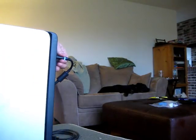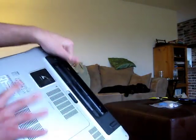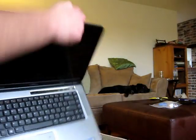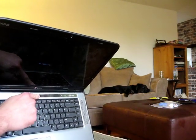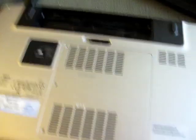First, unplug your laptop. Next, remove the battery. We remove the battery to prevent any accidental power-ons. We open the case back up. We push the power button — that's just some voodoo myth to discharge any ambient current inside the capacitors or anything else like that.